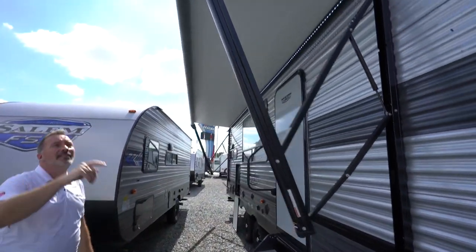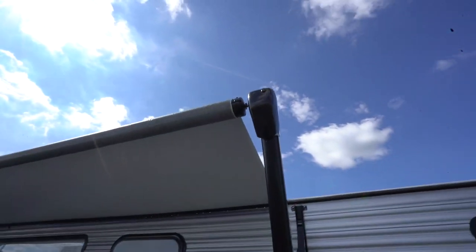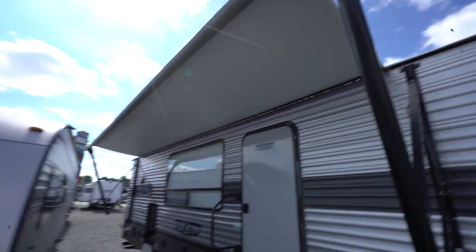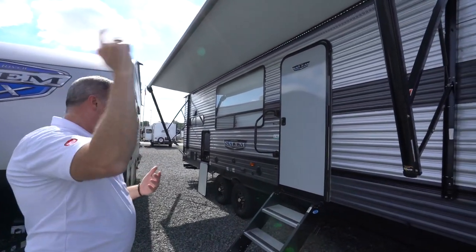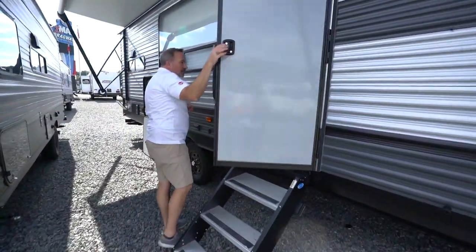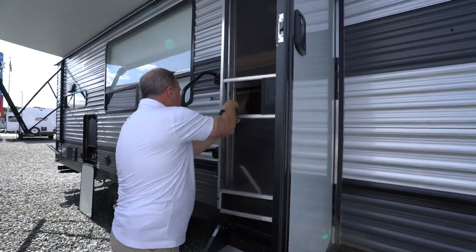You'll notice on your awning there's also a little rubber stopper over here on one of the sides. That's the manual override if you need to run your awning out in case you don't have power or if you lose power — it's a 7/16th drive in there, just put that in. You'll also have the Step Above solid steps on your Forest River Salem as well.